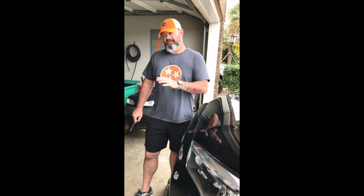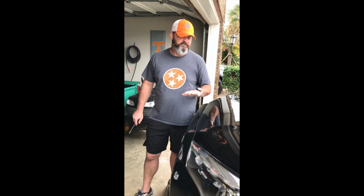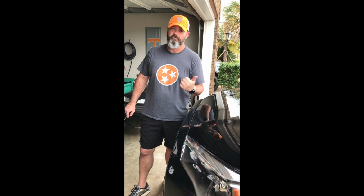I've also seen some folks online recommend to put a tap in there to clean the threads. A tap creates new threads. It doesn't clean threads. You're tapping brand new threads. You don't want to do that, or at least I don't anyway, on a brand new vehicle.